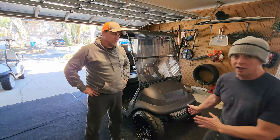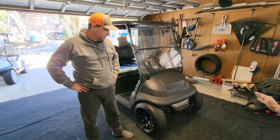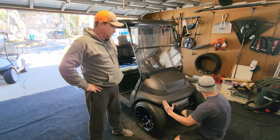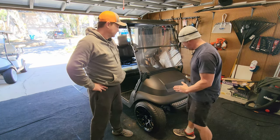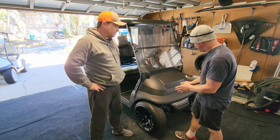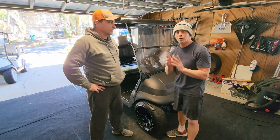And as you can see here, if you look down at the wheels now, there are absolutely no issues with the toe. Before, the tires were angled in like this. Now they're sitting perfectly straight. The steering wheel actually straightened itself out too, so we didn't have to make any adjustments. We didn't even have to do an alignment yet. We don't know if we're going to have to, but for right now it looks pretty close. So we're going to go out and take a test drive.